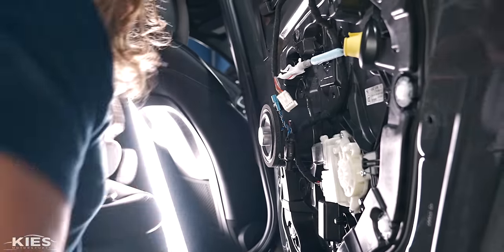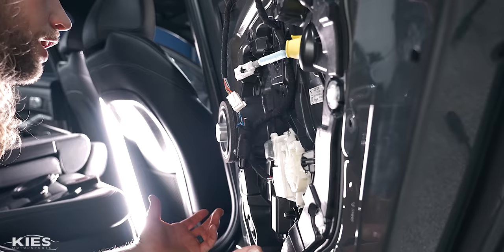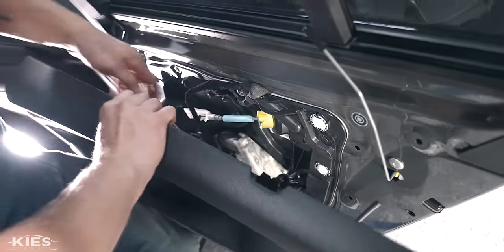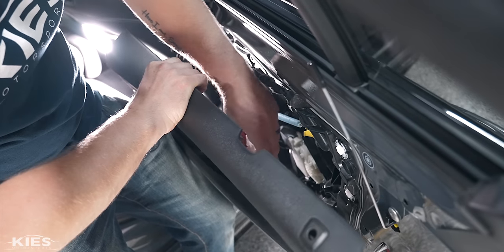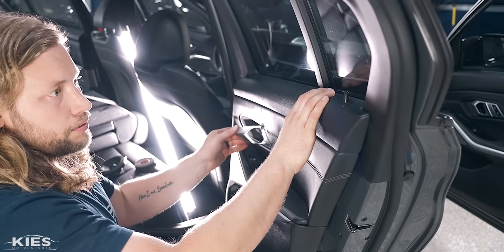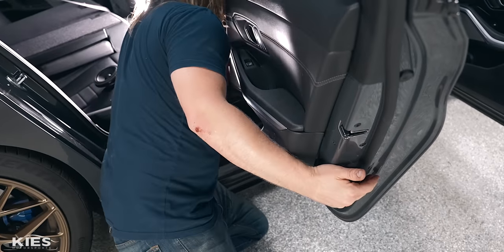Take the new speaker, plug it in first, and here's the little cutout — you can try to get it underneath the foam but a lot of times it just doesn't really stay. Your main input is over here. I'm going to zip tie this because I only need a little cord. I'll put some Tesa tape here just so there's no chance of any rattle. With everything ready, make sure you have the connector plugged in the right way before reinstalling the door panel.